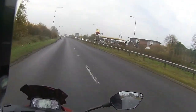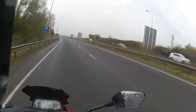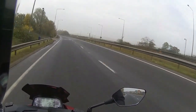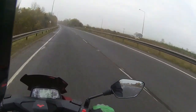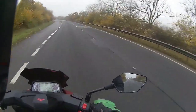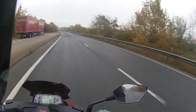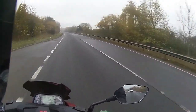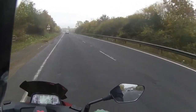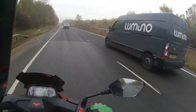We're going to do the hill climb first. I'm going to get it up to about 42, lock my wrist out and try to hold that throttle position to see what I lose going up the hill. Nice steady 42–43, holding the throttle in the same position. This is the steepest hill in Milton Keynes. It's dropping down a little bit — I've lost about two miles an hour still holding the same revs. Down to about 39, so you will lose a little bit of speed on a big hill climb, but you've always got the option to give it a bit more and open your speed up again.